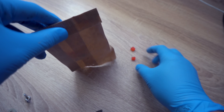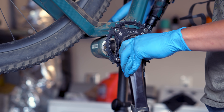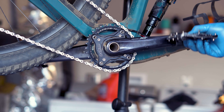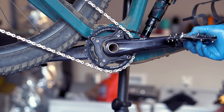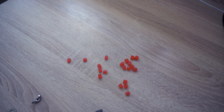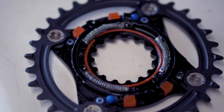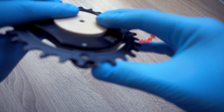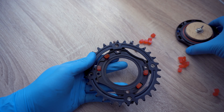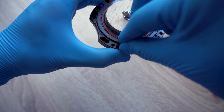I tried the 9 and 12-degree elastomers for a little while and found the added engagement a bit too much with very little to no added benefit. However, those that are primarily shuttling or riding bike parks might benefit by going straight to the 12-degree configuration right off the bat. Speaking of those elastomers, this isn't something you'll be swapping out trail side — I found replacing them extremely difficult as it required careful alignment of lots of small parts. Towards the end of the review, O-chain sent me a revised version specifically designed to make those elastomer swaps much easier, and that definitely was the case.